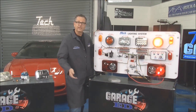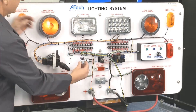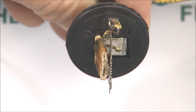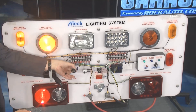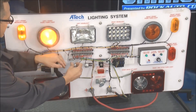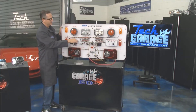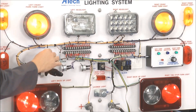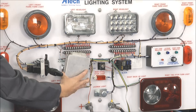The cool part is we talked about amps. If you look right here and hold it, you can actually see that flashing — amp draw, heat, no heat, heat, no heat — exactly what's happening, opening and closing like a little circuit breaker. Good tip: if you're trailing or putting some extra lighting on there, the hazard flasher is actually a heavy duty one because we're flashing all the lights. So you can upgrade — make sure you get a good flasher.